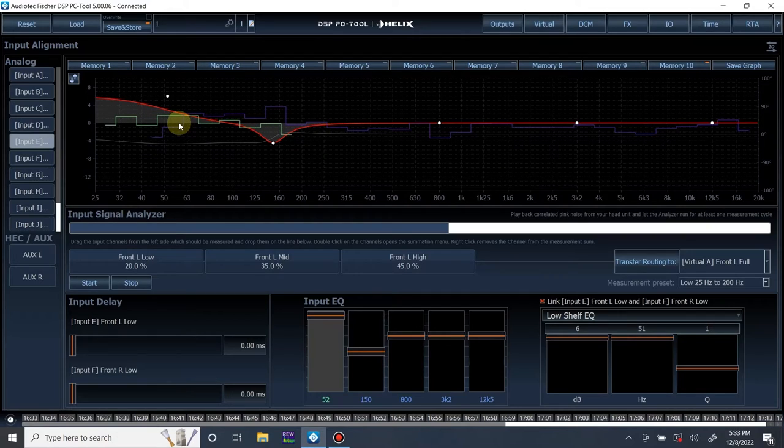Another situation would be where there is a subwoofer. I don't even know how to explain this in technical terms, but there are some cars where we use the subwoofer signal for the subwoofers and the mid bass, mid range, and tweeters for the front stage. But for some reason, in some of those cars, the subwoofer doesn't sound right. Something just seems off. I'm not even going to begin to think about what could cause that. But sometimes we actually use a corrected front or rear signal for the subwoofer instead of the subwoofer signal, because it just sounds better. It's timed the same.